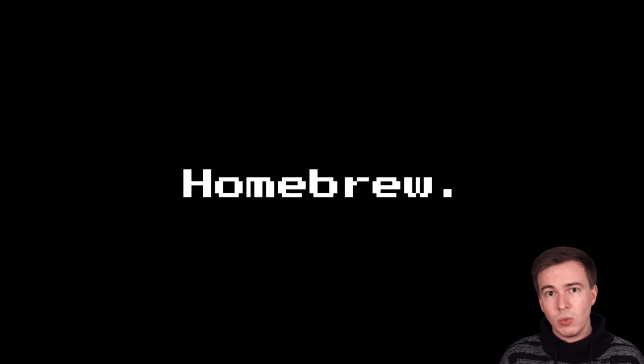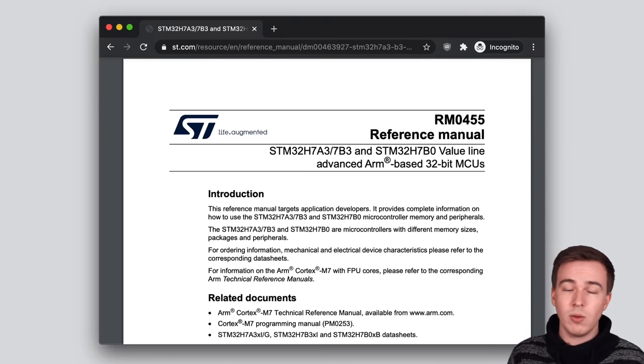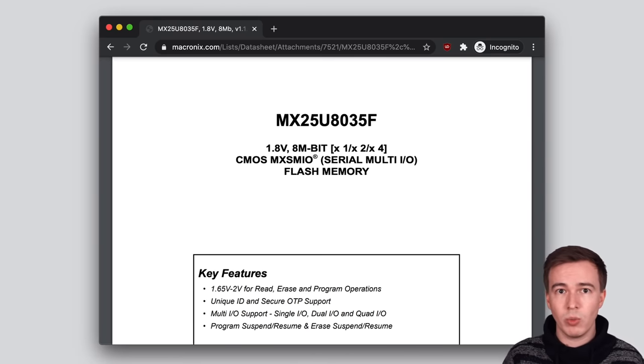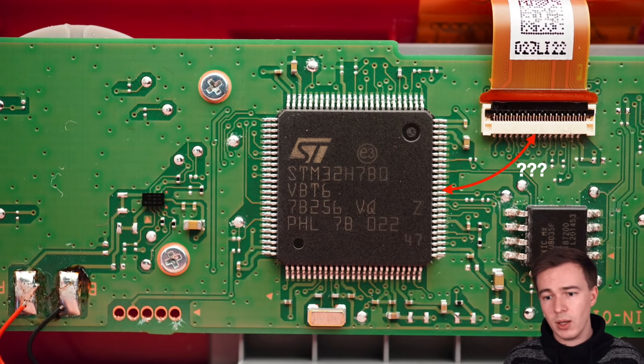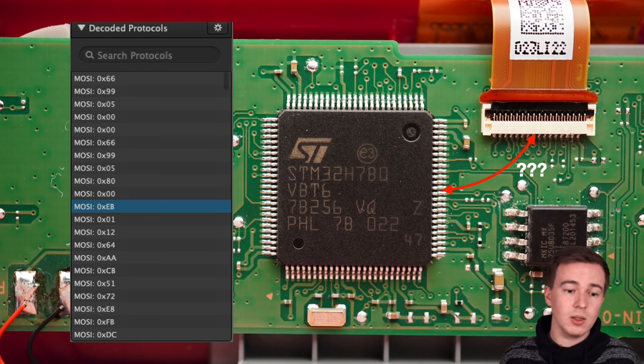Now, luckily for us, most of the components on the board are very well documented. And so there are no NDA components. And so, for example, the processor has an open reference manual and open source library to use it. The flash is a well-known flash chip, and so on and so forth. And there are only a couple of very proprietary or custom components. And so, for example, the LCD on the device is proprietary, and we had to basically sniff the SPI bus that goes to the display to basically decode the initialization of the display and so on.